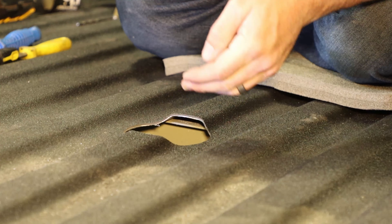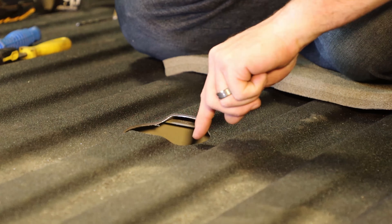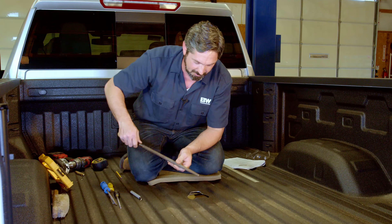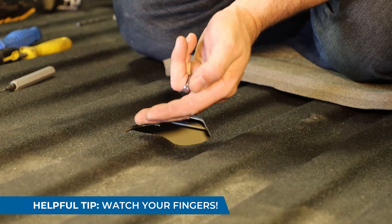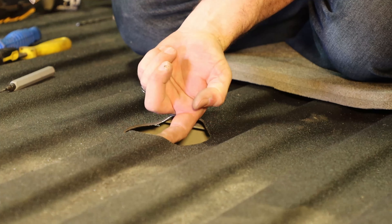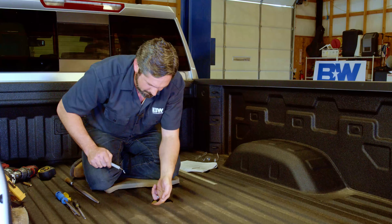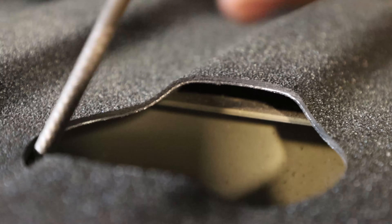After cutting the hole in the bed, make sure to eliminate any metal filings in the area so the center section can come up into the hole properly. You can use round files, deburring tools, or power tools — just be sure to get all the filings out. You can also go a step further by spraying clear lacquer or clear enamel paint on the rough edge to protect it from rust and corrosion. When checking for burrs with your fingers, always check with a direct motion rather than running your fingers around the hole to avoid cutting yourself.